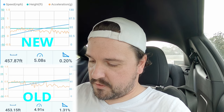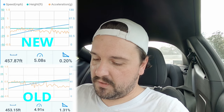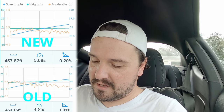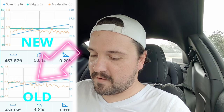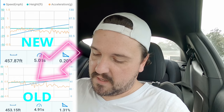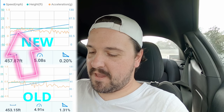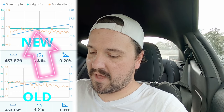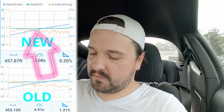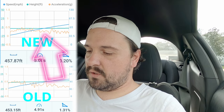Looking at the Draggy graph — on the run I was trying to beat, you can see a nice start and then it tapers off in that second box, because the turbo kicked in a lot sooner and then tapered off. It's completely backwards in this setup now. When boost came in, you see that little dip and then it goes up and holds power in the midrange through that second cell, and then it tapers off — but not nearly as much as it did on the factory setup. It's a little more consistent, especially in the upper RPMs.